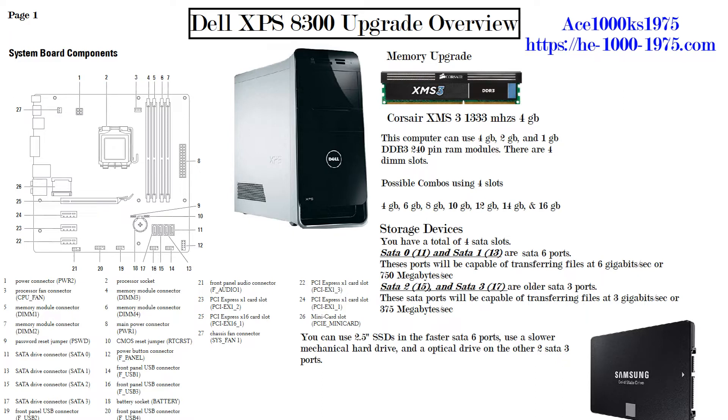You don't want to get more frequency than that — don't get a PC12800, which is 1600 MHz. Just get the PC10600.